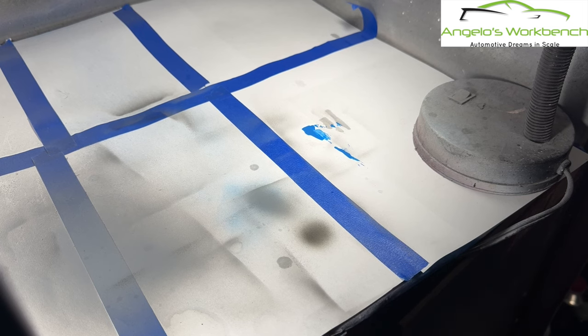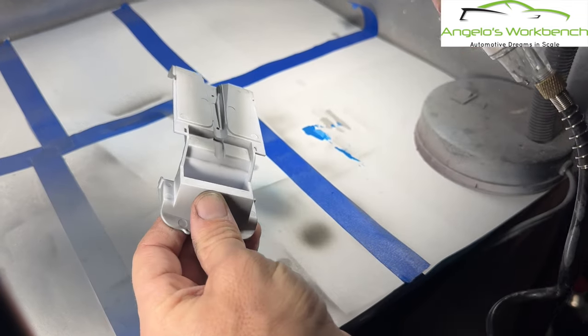Now we can do that side of the hood — a very light coat, it does not need to be a heavy first coat because I've got a lot of masking tape on. I shoot some air to dry it up and then go in with a little more paint. You don't want a really wet coat — capillary action will suck that paint right under the tape. That looks fantastic. It's got a nice sheen to it. I like this black. So now the hood can cure and we can continue with the rest of the parts.